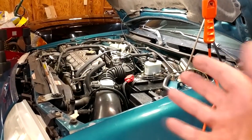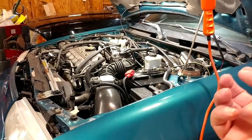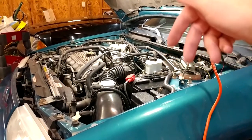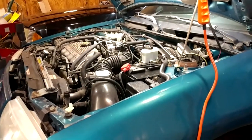What I've found on these cars is that when I get them, they're 20-plus years old. So even if they're low mileage — I think this thing's got like 85,000 miles on it right now — all the rubber parts are really old anyway. The axle shaft boots on this car I think are still intact, but they're all dry rotted. They're going to split out at any minute and sling all the grease out.